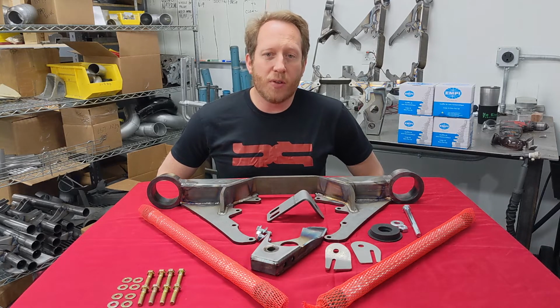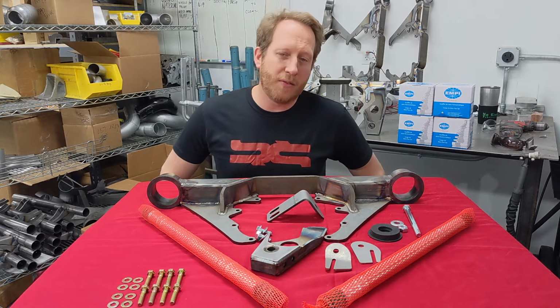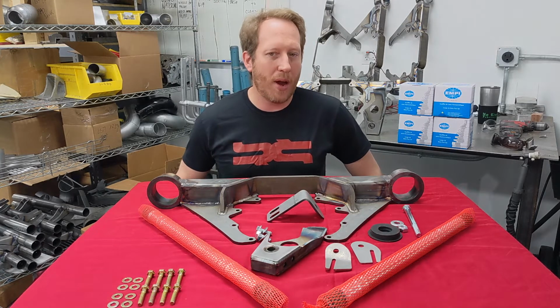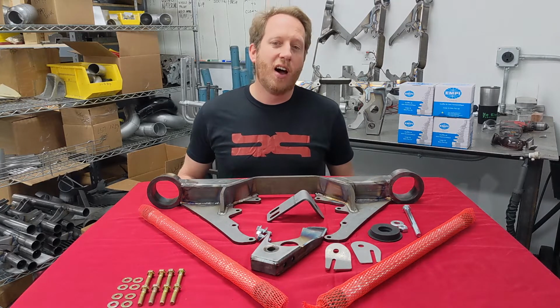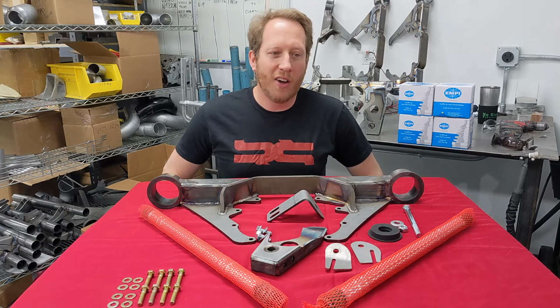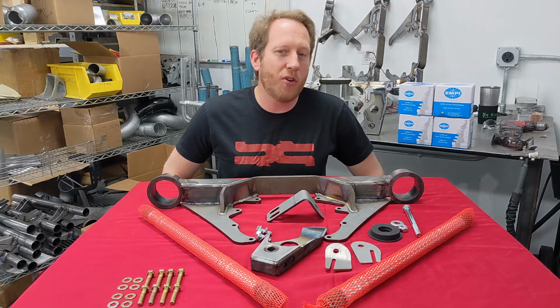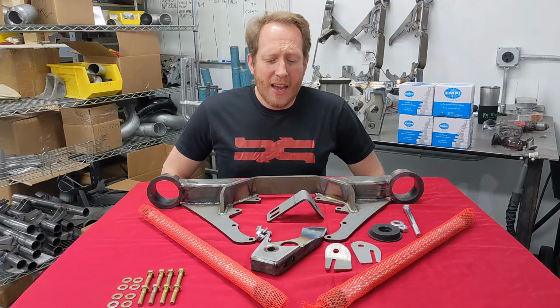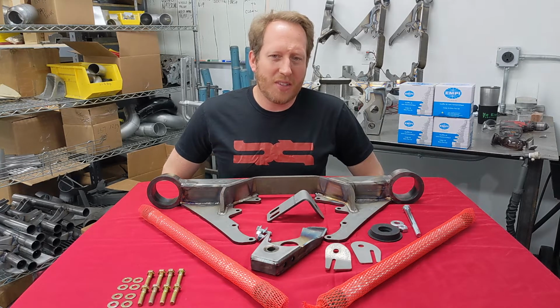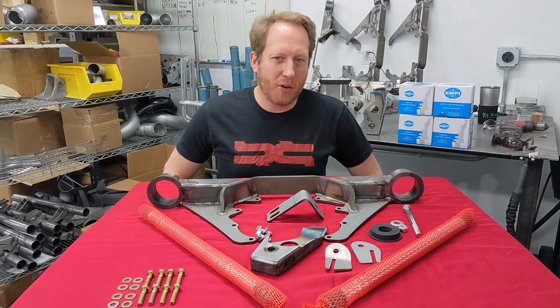So this is using a differential from a 2002 to 2005 Ford Explorer. It's kind of an interesting setup in that it's got a single front mount, but all of the internals are from a 31 spline, the same stuff that came out of a Terminator Mustang Cobra. You can even get a factory LSD if you get one from a Sport Truck model. So you might be asking, why use SUV parts when you could have looked at the Mustang Terminator stuff in the first place? Well, the answer is that the single front mount notably improves things in terms of packaging.